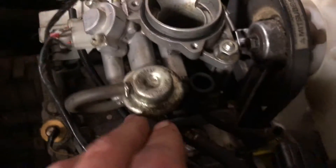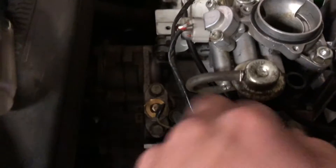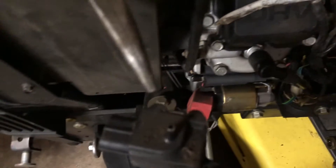I pulled the fuel back in. This bolt's on here. This little tube comes up there, so the return fuel line comes there to the bottom of the regulator. This fuel line return goes down to the bottom of the throttle body.